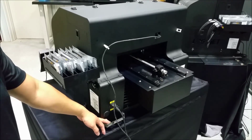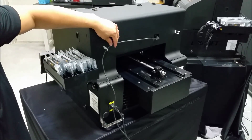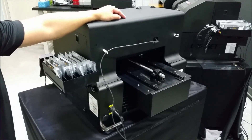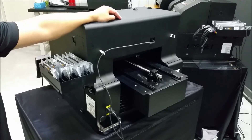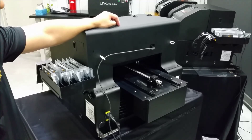This video is on cleaning the encoder wheel assembly at the back of the printer. The reason for cleaning it is if there is an issue with the bed movement or registration — you get a paper jam error or a PF motor error.